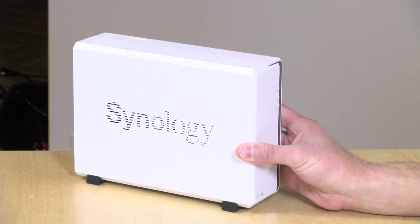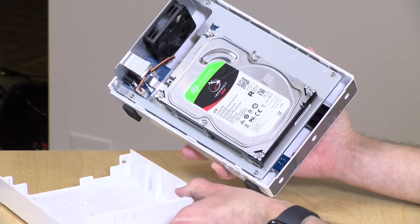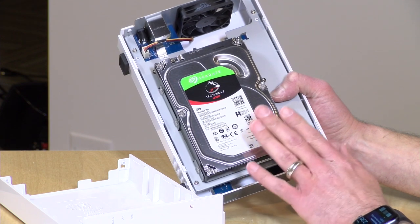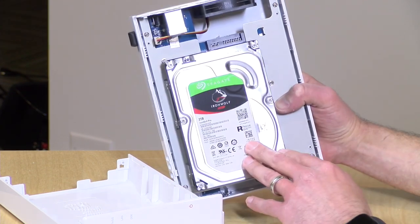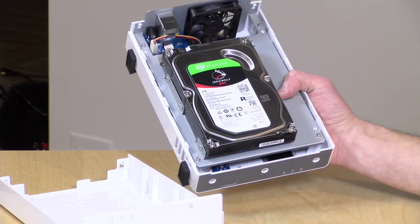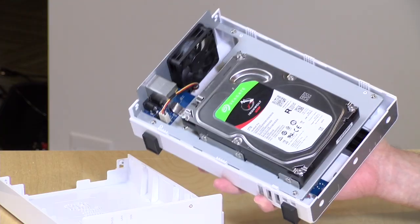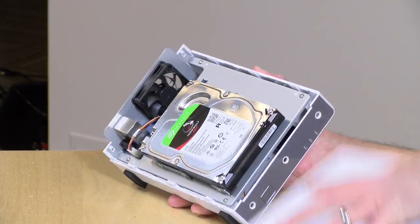So let's take a closer look now at the hardware. The unit costs about a hundred dollars, so really not all that expensive to get in the door, but you have to bring your own hard drive. There is no drive in the unit when you buy it. This one had a Seagate Ironwolf NAS drive installed — a two terabyte drive — when they sent it to me, but you can use pretty much any desktop hard drive up to 14 terabytes. You can also get smaller two-and-a-half inch SATA drives to work with this as well. I do think having a NAS-certified drive inside your network attached storage device is the better way to go. Those drives are a little more robust in their mechanisms, so they'll last a little bit longer, especially if you have these things running all the time, and the warranties on NAS drives tend to be a little longer than on cheaper desktop drives.